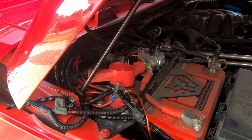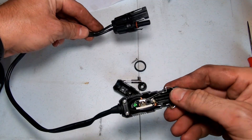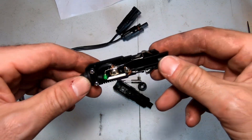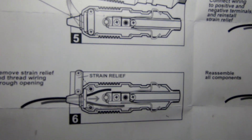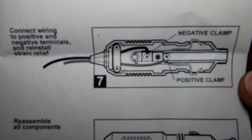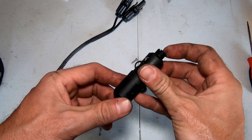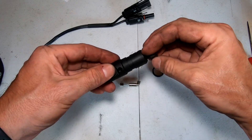Let's go over how our plug works — that goes to our solar panels, then we'll get everything plugged in and see if it works. Let's take a look at the 12-volt Blue Sea Systems plug. We repurposed our MC4 wires that used to go straight into our charge controller. This whole thing basically comes apart — there's a diagram that shows what's going on. You can see here that there are positive and negative clamps, so you don't even have to solder if you don't want to. You just reassemble and you're good to go. This fuse cap end just goes on like that.